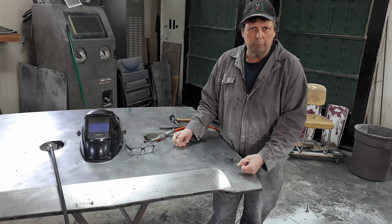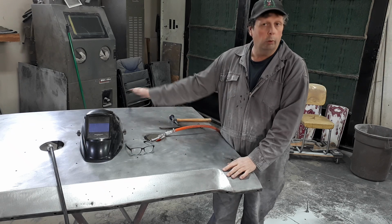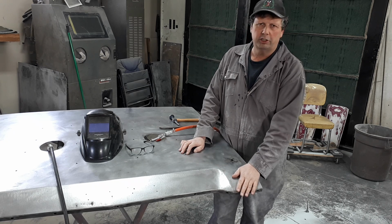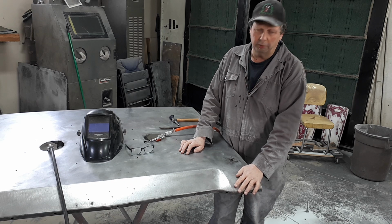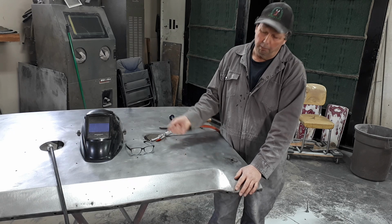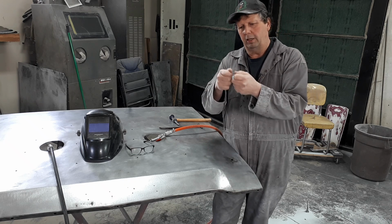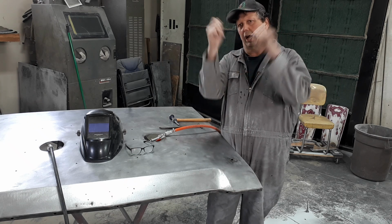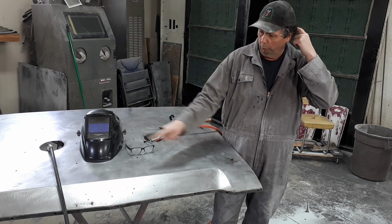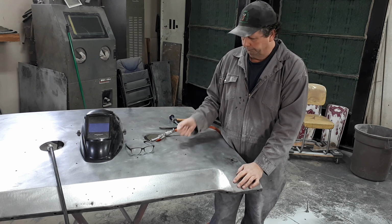I'm not going to get into the argument about heat. Don't give a shit who says that it's heat that kills it. A lot of heat will warp it, absolutely, but in welding, it is very rarely. Unless you're just Johnny Cowboy with the welder, you shouldn't be getting enough heat in there to do that. So what it is, is the shrinkage of the metal. It pulls the steel, and something's got to happen, so the steel will either give way in, or give way out, and that's where it puts your waves in. And a lot of times from a weld, it'll put a wave in over there, because the weakest point of the steel is where it's going to give way.